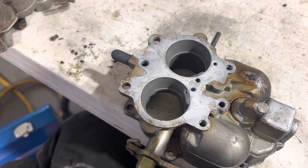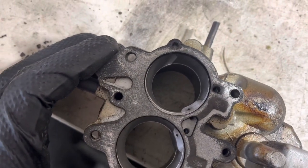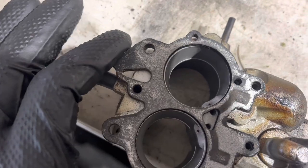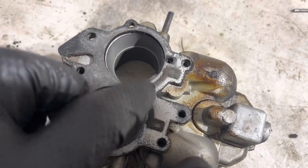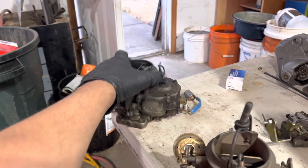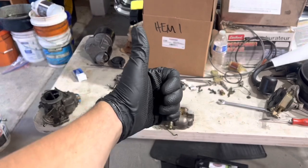When you're assembling this, your kit is going to come with a couple of different gaskets, and you need to make sure you've got the right one. Make sure all of the holes have holes. This accommodates a different version of the carb too — that's fine. That port doesn't go anywhere, so it's not a vacuum leak. But all the important stuff is there. Which reminds me, I'm going to have to look really closely at my replacement and make sure all the holes are the same. But I can't do much more without the correct carburetor kit, so that's tomorrow Jamie's problem.